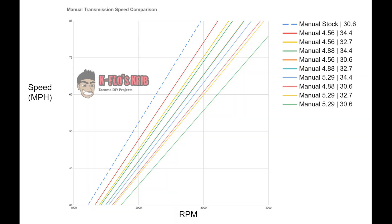Here's a guideline: if you're adding less than 500 pounds, you can probably stay at the gear ratio you picked. If you're adding more than 500 pounds, go to the next higher gear ratio. If you're adding more than 1,000 pounds, go two steps higher. The heavier your truck, the more torque you'll need and the higher gear ratio required. Before I re-geared, I had stock gearing with 33-inch tires and had to keep downshifting from sixth to fifth gear on any slight incline on the highway, which killed my gas mileage. With my four-wheel camper weighing over 1,000 pounds, I would go from 4.56 and skip to 5.29.